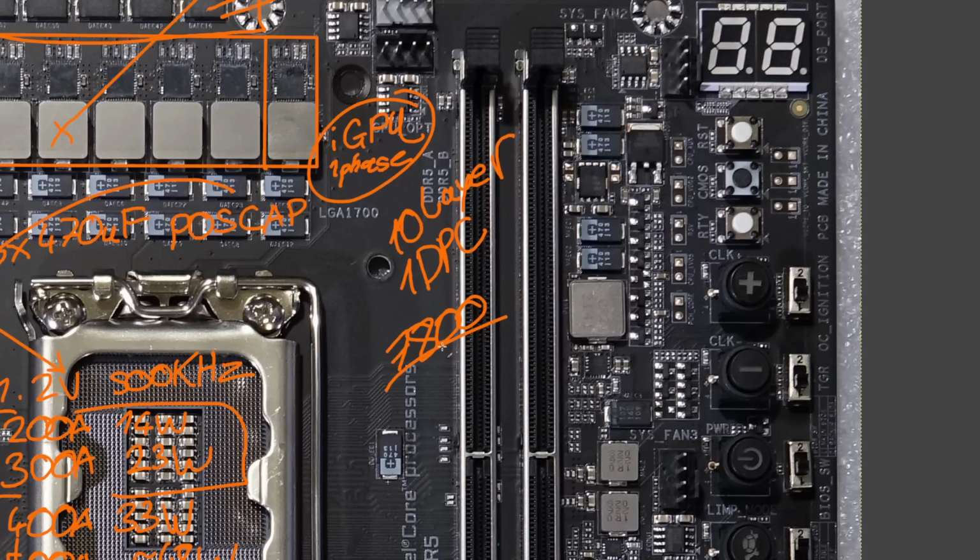I don't know how Gigabyte determines what they put on their QVL. I don't know what stress tests they use. If they use HCI MemTest, or if they use MemTest86, I can totally understand how DDR5-8000 managed to get onto the QVL. Again, I actually don't know how any motherboard manufacturer stress tests for their QVLs. But yeah, Gigabyte QVLs the board to 8,000.